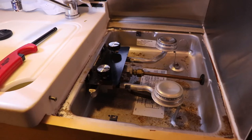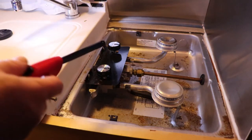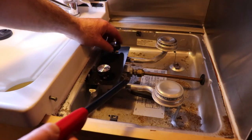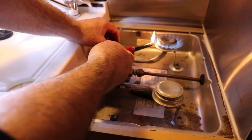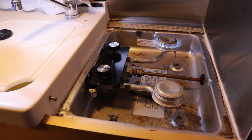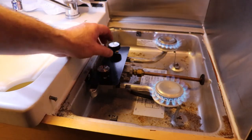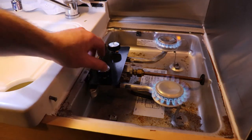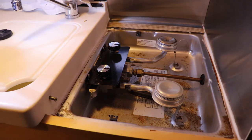I cleaned out the fire element with some soap and water — didn't have any compressed air available. Things are still kind of loose, still troubleshooting. It's just slow to start because it was still full of water. But — success! I'm going to turn these off since I don't have the fan running. So if you find you've got some kind of really orange flame coming out of your machine, it could very well be that you just need to clean out the elements with some soapy water. Thank you for watching.